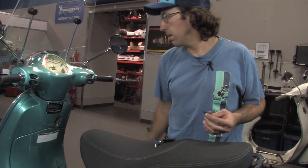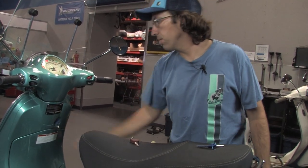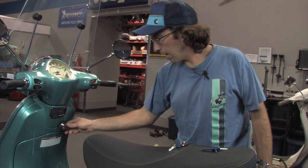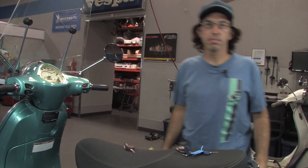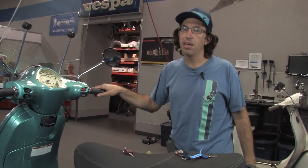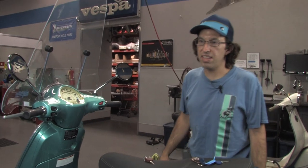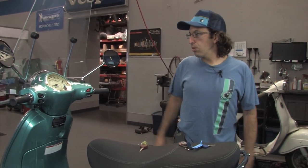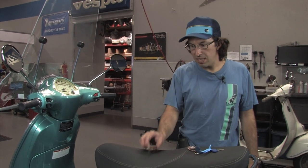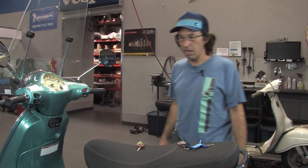I'll go ahead and program that key back in. Watch that light — right when the light turns off, pull the key out; you've got to do this pretty quickly. End with the red key again, and now I have both blue keys programmed into the system. That pretty much sums up how you program the immobilizer found on many Piaggio scooters — all Vespas except the Vespa S and 50cc scooters. The system came out in 1996 during the 50th anniversary when the ET4 was introduced. Newer scooters like the 946 or BV350 use the same system and programming but have a sidewinder cut key versus the standard double-sided key on older Vespas.